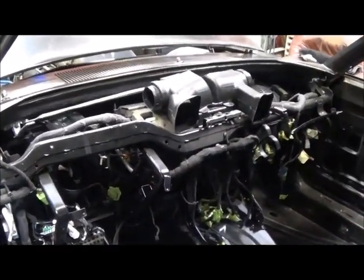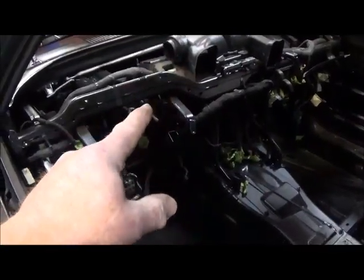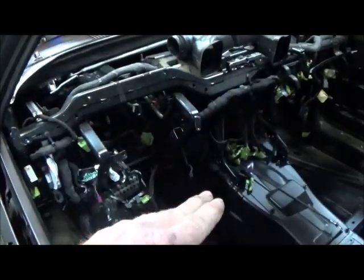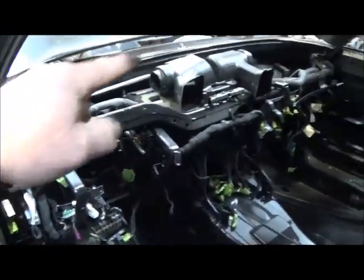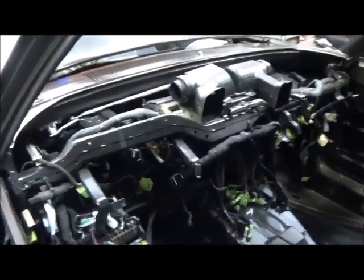I've had to move it around just a little bit, but couldn't do much because I set the dash location back in its factory spot here. I had to lean it just a little bit, but it matches the console. So I installed the console, pulled the dash up to it, then made all the bracketry, because everything on the floor is Hellcat. Everything up here has been fabricated and located.